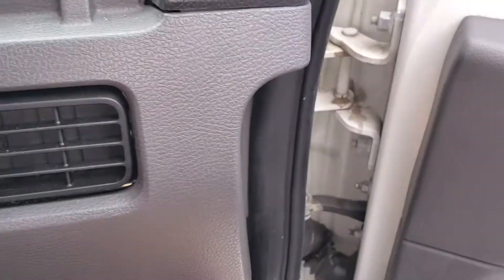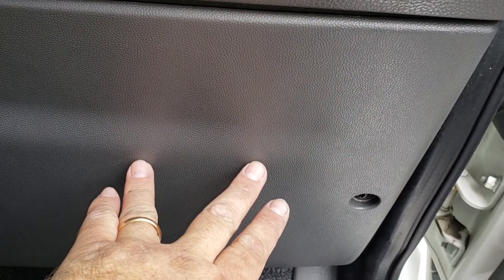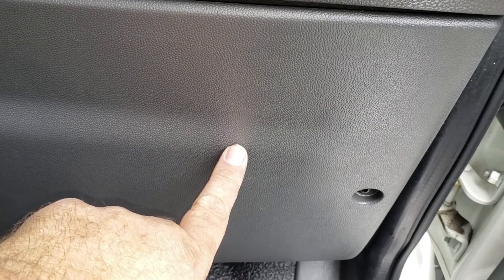You'll fish your wire down. There are two Torx screws right here — there'll be a module right behind here with your CAN bus wire, the green and the yellow. So you tap right there.